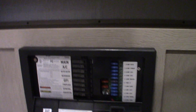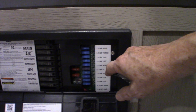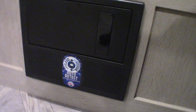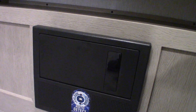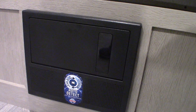This is your power converter. It converts AC to DC power — you start with 110 AC here as long as you're plugged into shore power, so you've got 110 AC circuit breakers like you'd see at home, and they're labeled. Then the power is converted to 12-volt DC over here, so you've got 12-volt fuses, and they're labeled. This is also a battery tender — it's going to sense how much energy your battery up front on the tongue needs and send as many amps as necessary to keep it charged. When you're plugged into shore power, this will be charging your battery. When you're pulling down the road, your tow vehicle's alternator and charge line will be charging the battery. And the solar panel is always sending amps to the battery depending on conditions outside.